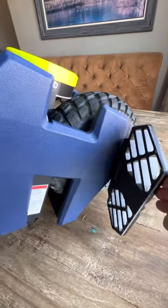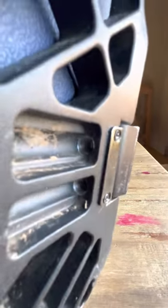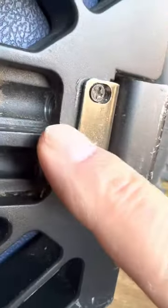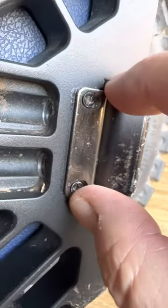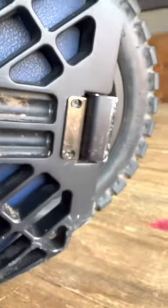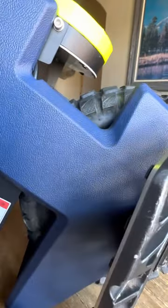I just wanted some angle because what I've found is that angle just pins your foot against the sides. The way you do this: there are basically two slots here - you can get an allen key in and there's an adjustment screw in each of these two holes. First, you loosen these two screws, then these adjustment screws push the whole plate forward towards this bar. Tighten the two screws back down and when the pedal comes to rest, that bar is a little closer to it.